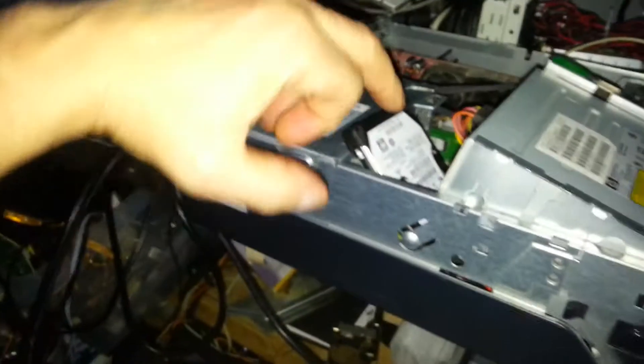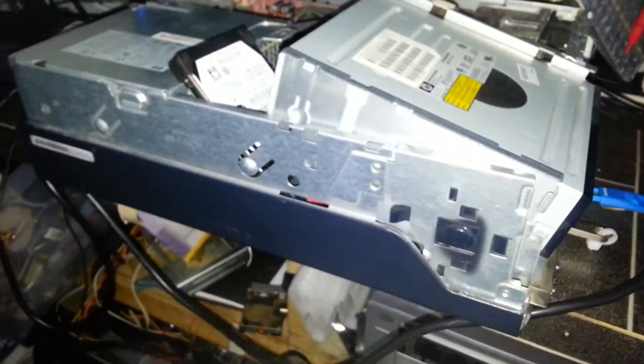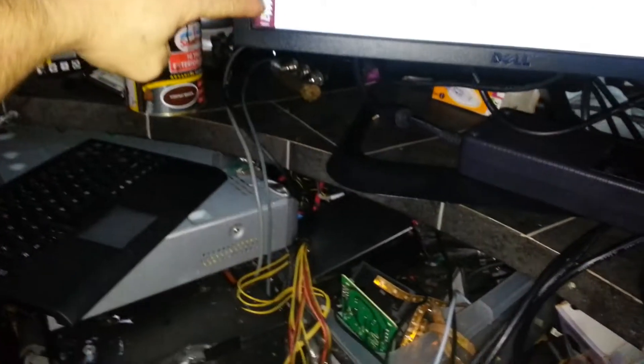The good thing is that if you've got a funny machine like this HP that locks you right out of the drive, you can put the drive into another machine — like this one, it's just a platform you can move stuff in and out of nice and easy. Put the drive in, boot from a live Linux CD, and that hard drive will be listed in here. Also what you do is stick a USB stick in as well.